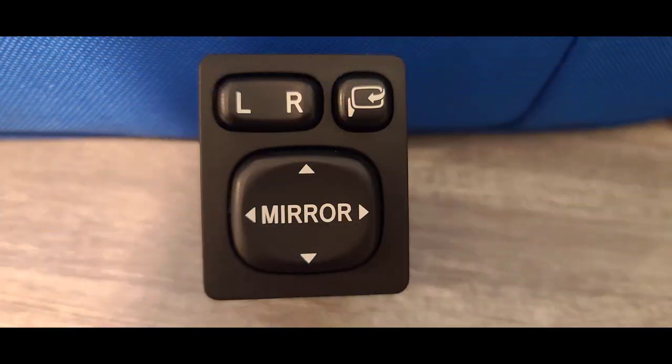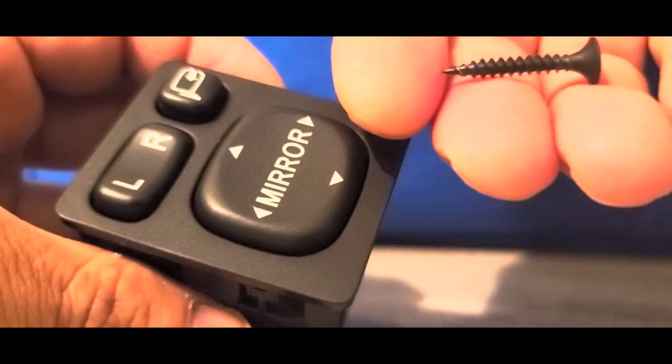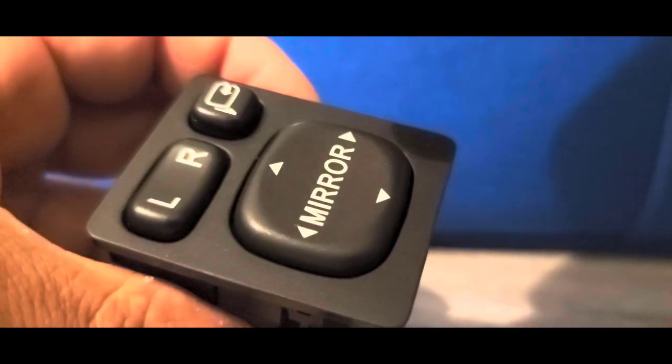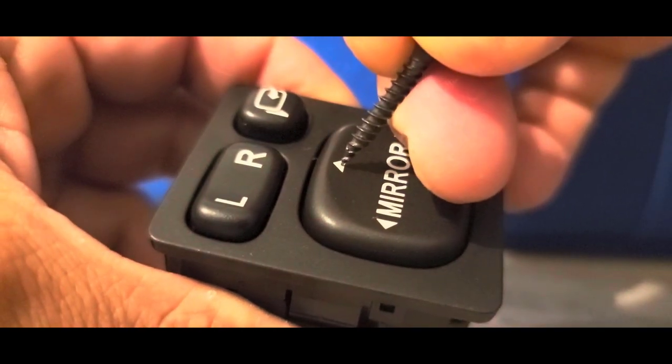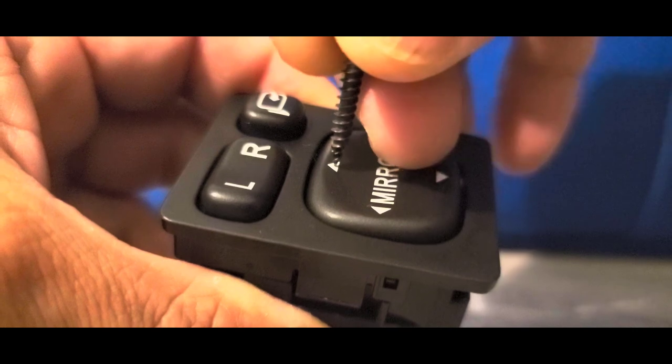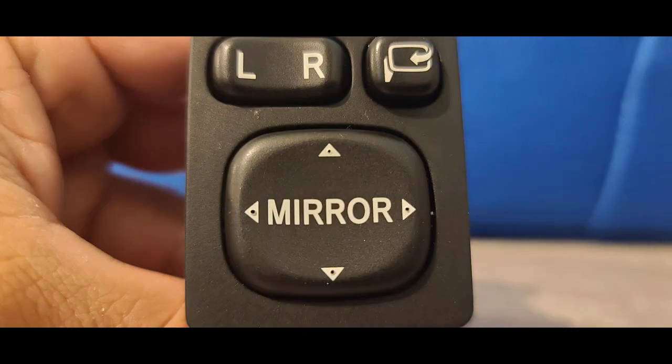I identified the following spots to make holes in order to illuminate a dot on every surface that can be pressed in the switch. Since I always try to use things that I have at home, I used a board to make marks for each hole so that the drill bit doesn't slide and scratch the surface of the button. I took my time to do this carefully, so I started with very low pressure and increased it little by little until I saw a good mark.